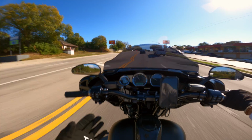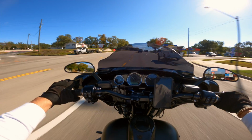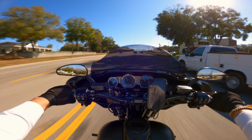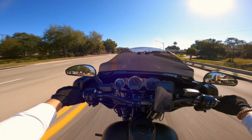That's the reason why it's not shifting into gear properly, because look, I can downshift perfectly. So long as it's just depressed slightly and not depressed all the way back, it shifts super smooth. So I'm assuming that really is the issue. Yeah, look at that, perfect shifting. So long as I don't depress the clutch all the way down, just slightly.